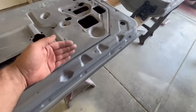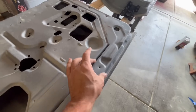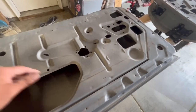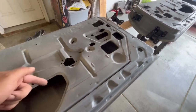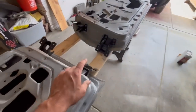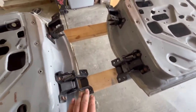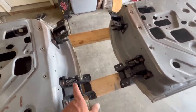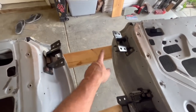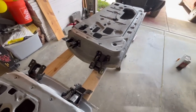We're just going to paint the inside of the doors around here. Remember, your door panel — door card, whatever you want to call it — comes down to about where these holes are, so you want to get it painted up to at least there. You don't have to paint the entire door shell. There's still going to be dirt that may blow around inside, so I'm not going to shoot any air down inside the door. We're going to focus on the outside edges of the door and try to get these hinges painted — with the hinges in the door wide open position, because that's how you see the door when it's open.